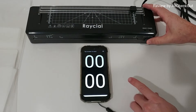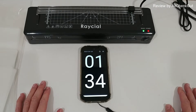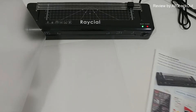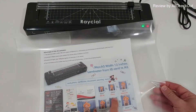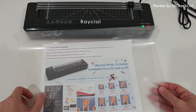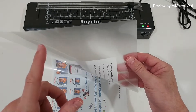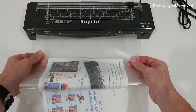Let's turn it on to hot mode and see how long this takes. We're ready in basically 90 seconds — exactly as expected. We select a suitable pouch; in this case we're using an A3. The pouch has to be a little bit larger than the printed size because it needs some area to seal. By the way, the pouches included are only for hot laminating — for cold laminating you have to buy something else.